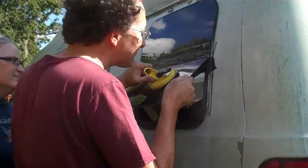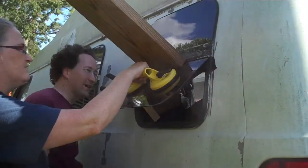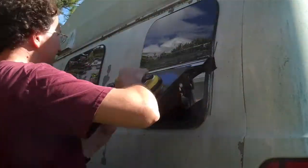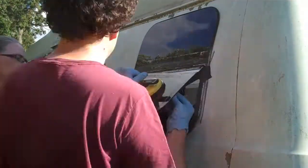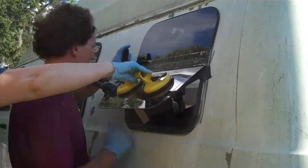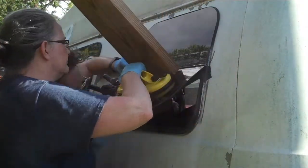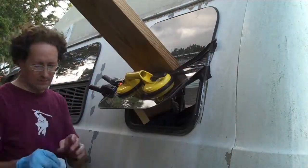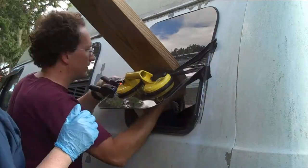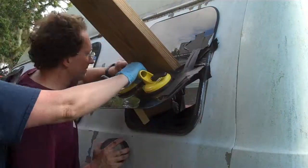The next bit is a two-person job, so grab a helper. We worked through the full procedure in a dry run without glue and figured out how to balance a piece of lumber to provide the downward and inward clamping force, and also figured out where to place the other clamps to hold the support track to the glass. Removing the entire window from the van would have made clamping easier, but I was able to use a collection of clamps, a heavy piece of lumber, and lots of gaffers tape to get the glass clamped to the hinge piece overnight. The helper's job is to keep the glass in the right position until you can get all the clamping fixtures in place.